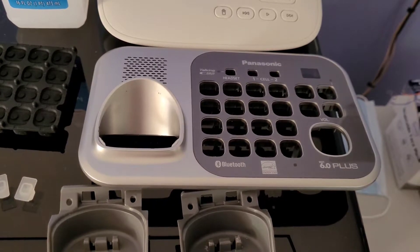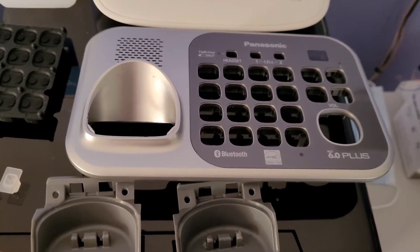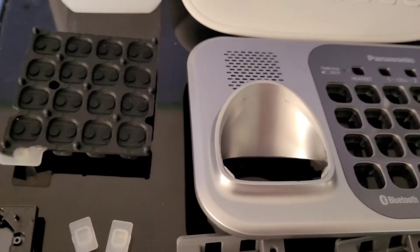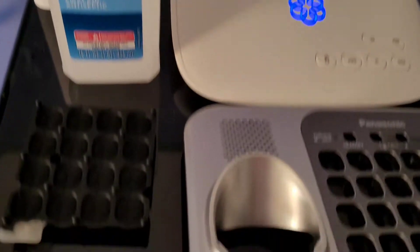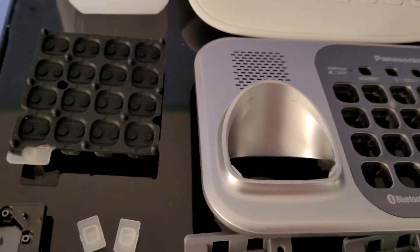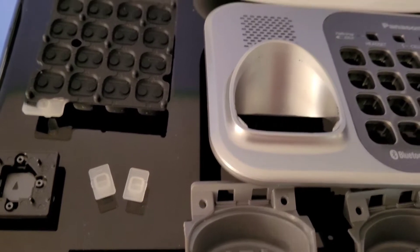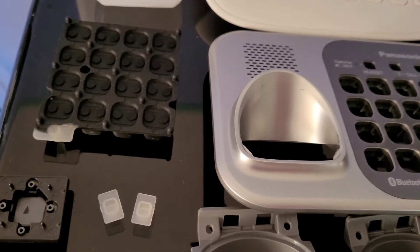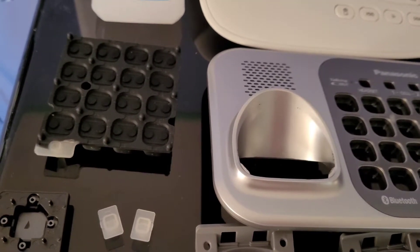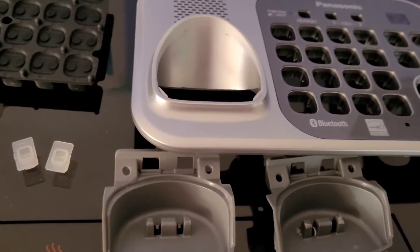Finished cleaning up all the pieces. You just use soap and water - that's self-explanatory. Don't use any harsh chemicals otherwise you'll damage the plastic. For cleaning the carbon contacts, I use 91% alcohol and lightly clean them up - just one or two passes. You don't want to take too much of that carbon out otherwise it won't be as sensitive. I'll actually one day show you how to rebuild these when they lose all the carbon - I actually have the paint to paint over that and make them good as new. But in this case they're in good shape.